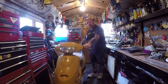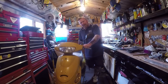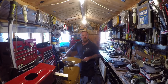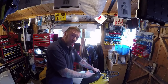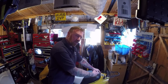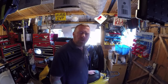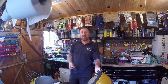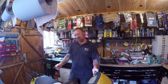Little bikes. What's wrong with this one? It sat in the shed for 18 months and it won't start. The guy was oddly told that the petrol tank allows water to get into the carburettor — so if it rains, water gets in the petrol tank from this sealed unit. I had to politely say that doesn't actually happen. More likely because the bike hasn't been started in 18 months, it's got stale fuel on it.